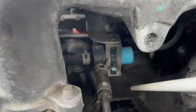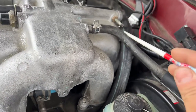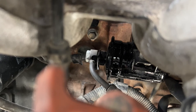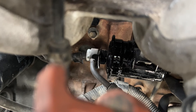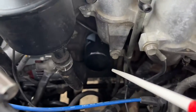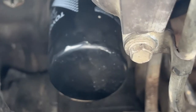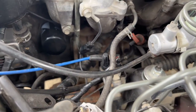There are a bunch of vacuum hoses lying down here under this plenum — they all control the EVAP and some also control the EGR. Right under the lower intake manifold, that's where the fuel filter is. You have a fuel line going in on the left and fuel going out on the right into the fuel rails. Right below the power steering fluid you have the oil filter — I stick with Toyota, it's about $6–$8.